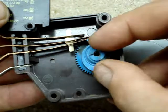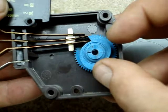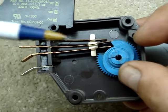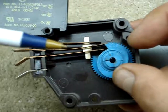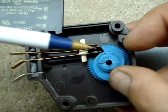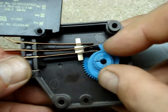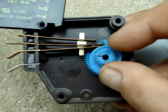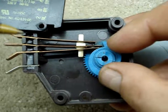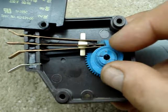Now, as we move these, you'll see — boom — it's now on the defrost cycle. The defrost is running power between these two because the always-hot power lead is now connecting to these two springs. And if I advance this just a little bit — click — you'll see it has switched from being continuous between here and this lead to now being continuous between here and this lead.